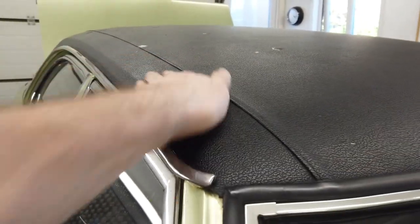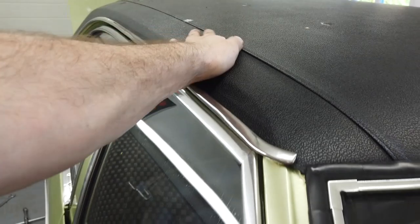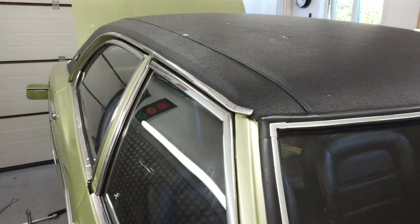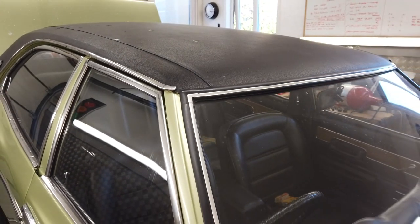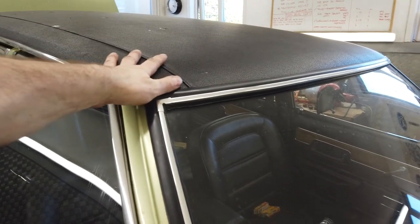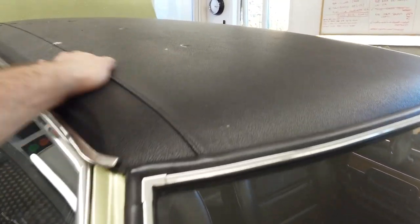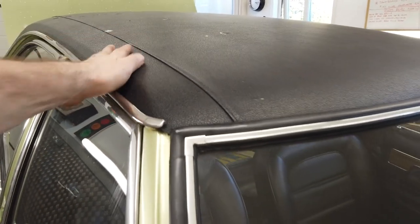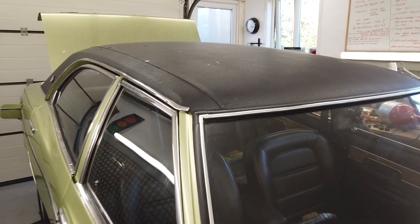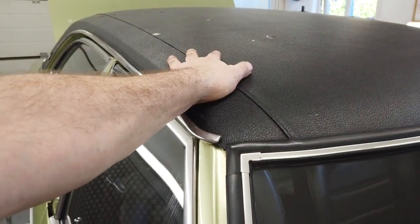It's not the glue. It will be rust on that, where they've sanded that for the glue. And you know, all the cars I've done since, I've told them, make sure you don't go bare metal through. Some of them, when I've pulled vinyl roofs off scrappers, it is bare metal with glue on top. And the vinyl roof guy said to me, well, that's how we used to get them in. I said, yeah, well, that's why they always rusted. A lot of the time you get a vinyl roof and it's rotted because of the way that's been prepped. So that was a mistake, really, there.